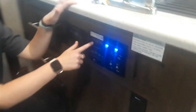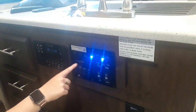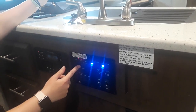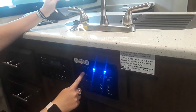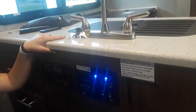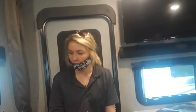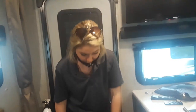Right here you have your tank monitor panel — kind of like a battery gauge. BATT stands for battery. The batteries I showed you in front behind the LP tank are F, so it means they're full. Fresh, which is your fresh tank that I filled up, is full. I filled that up so you could run as much water as you wanted to make sure everything was working. Your black tank is empty and your gray tank is empty. If you're worried about whether your fresh tank is full or if your black tank needs dumping, just press the little buttons — whatever it lights up. You have empty, one third, two thirds, and full.